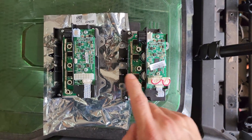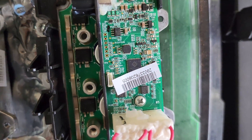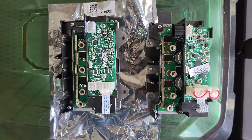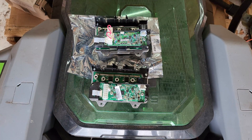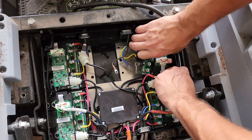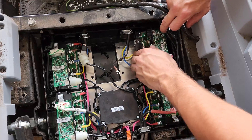One thing we'll need to do is move the jumper connector over to the new board — it just easily unplugs. Go ahead and gently place the new board into its respective spot. I recommend being smarter than me and putting the frame screws into the board before setting it in, as you're about to see me drop these screws a few times.